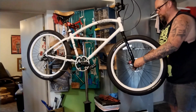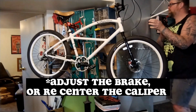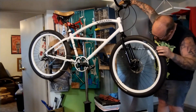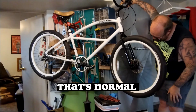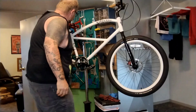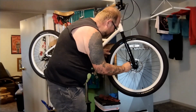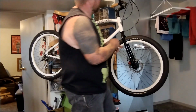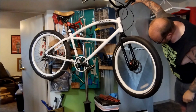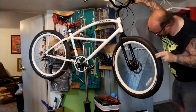My bike that's this finicky and weird will probably have to play with those caliper bolts. You hear it, it was rubbing a little bit, but barely. Mostly on this outside. Inside, where it needs a little bit of adjustment. A lot of gap in there. You can hold up a white card behind you or a light so you can see that gap.